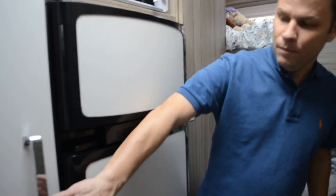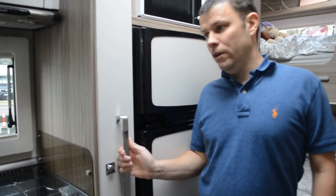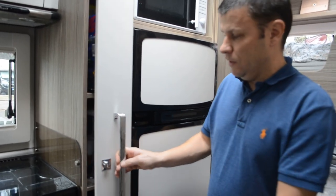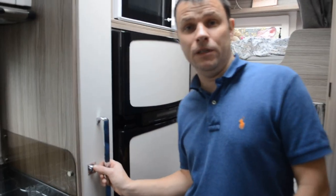One of the other little things we've done: whilst we were driving, this larder unit has only got the one button to lock it into place, and sometimes it used to come open. What I found was it wasn't quite catching tightly enough — there was a bit of movement in it. So all we've done is put a spacer just there where it catches, and since we put that spacer on we've had absolutely no problems.